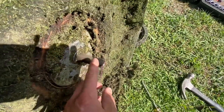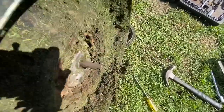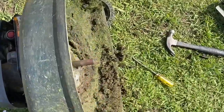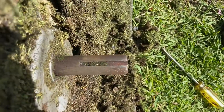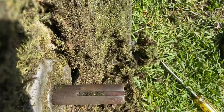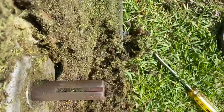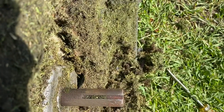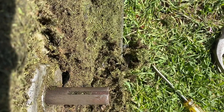Now that we've got this nice and clean, we're going to pull the spark plug out and pull the cord — I'll show you that it's bent. Spark plug is out. It's going to be hard to see on camera, but check it out — it's definitely warped, like a lot. I can see it wobbling like this, and that's what's causing the vibration.